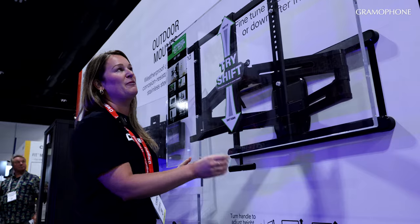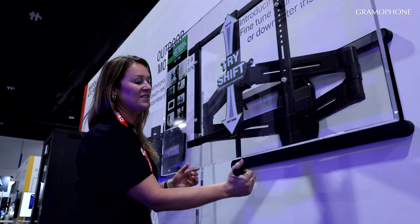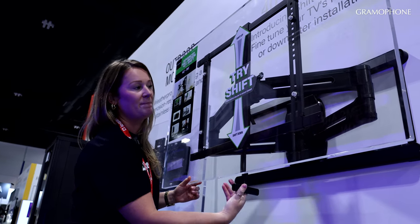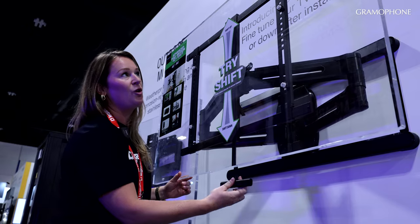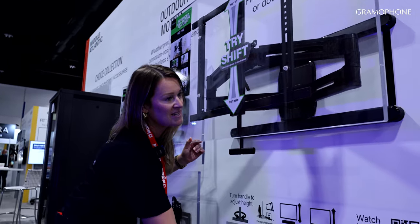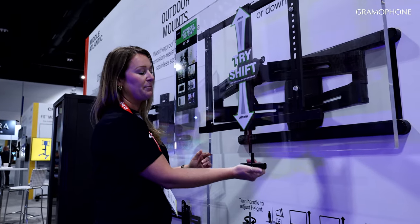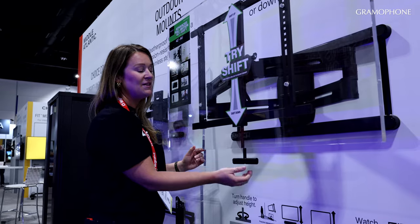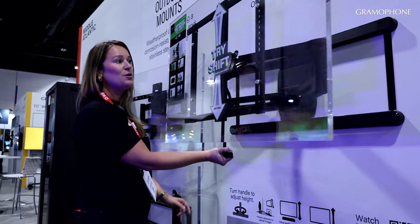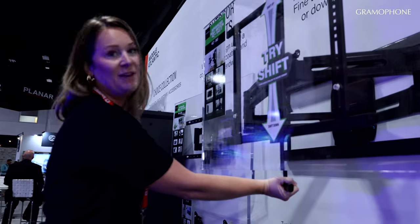So if you want to get it perfectly a couple inches up or a couple inches down, you can do that just by the twist of this handle — I'm going up here, the TV's going up — or you can bring it down. You've got eight inches in total, four going up and four going down. You can take this handle and bring it all the way down for larger TVs to accommodate those. And when you're done, bring the handle back up behind the TV so you don't see it any longer. You can also use this as a handle to move the TV around without putting your hands on the TV and leaving fingerprints.